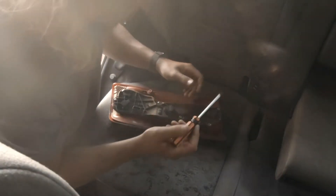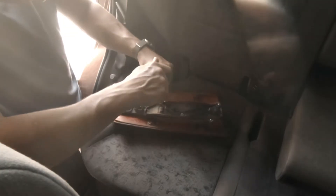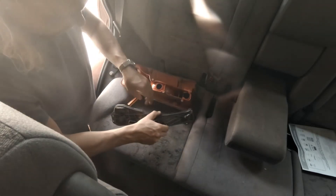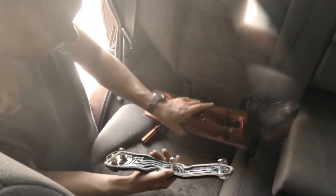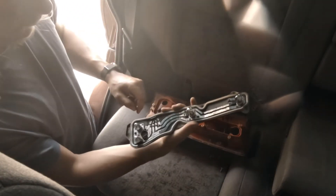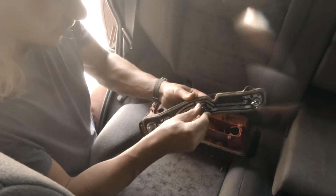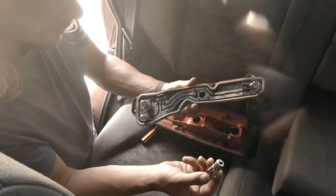Once again it's just the Phillips head connection. I'll lift that off and tip it so all the screws come up. The brake light bulb is the one in the middle. Gently push it in, turn it anti-clockwise and pull it.